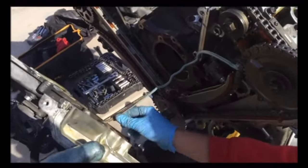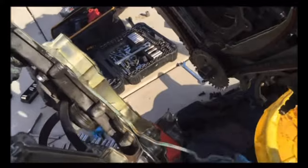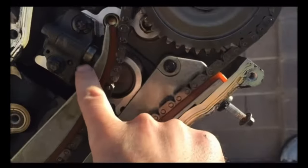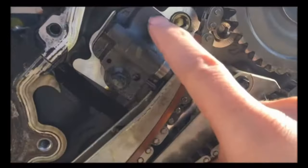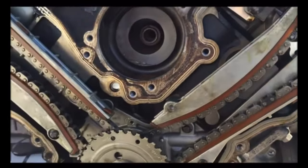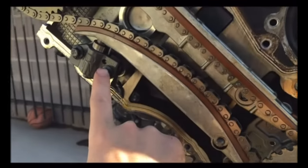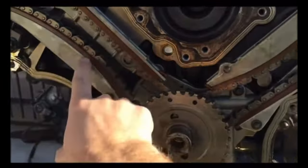So this will hopefully just be a simple fix — just take off the front timing cover and replace it with two new timing chain guides and tensioners. So stay tuned for more content. It'll probably be a bit until I can get to it, but anyway, that's what's going on. Let me know in the comments what you think. Thanks, guys.